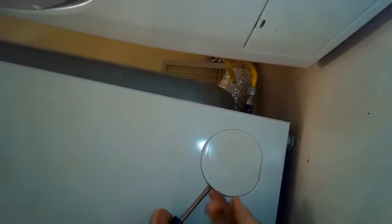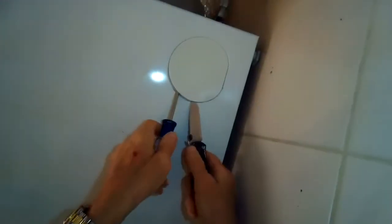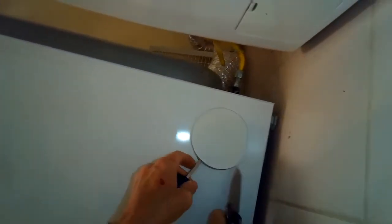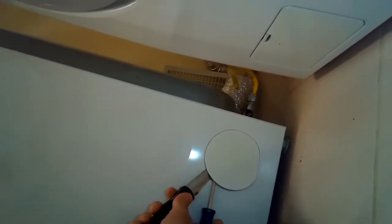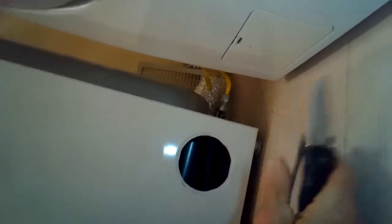And inside, a little bit to the left, is a thermal overload switch that is on the burner tube, and it has a little button on it, and if you press the button it resets the thermal overload and then the heat will work again.